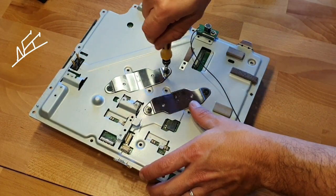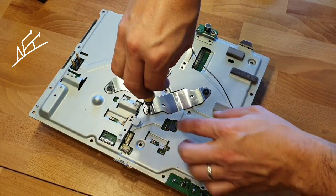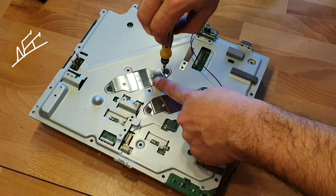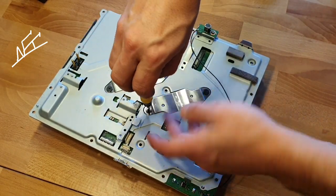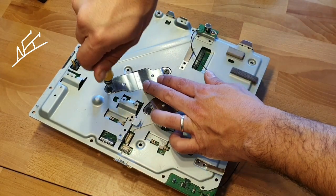When you are closing the CPU and GPU clamps, work always parallel. Do not just screw one screw all the way to the end and then go to the next. Go about one, two, three times on each — like me: one, two, three, one, two, three. And make sure it gets really perfectly closed.